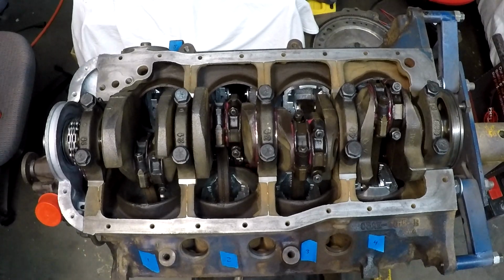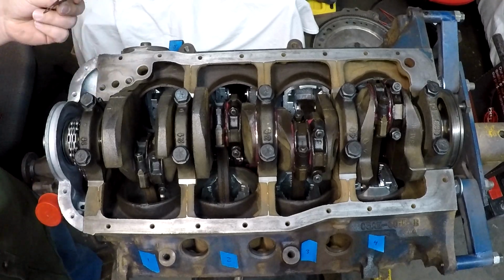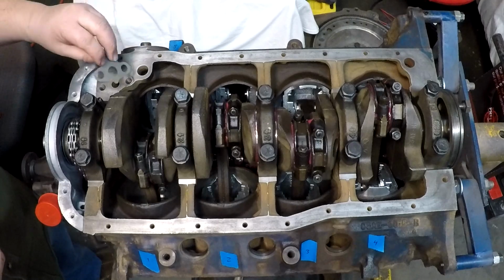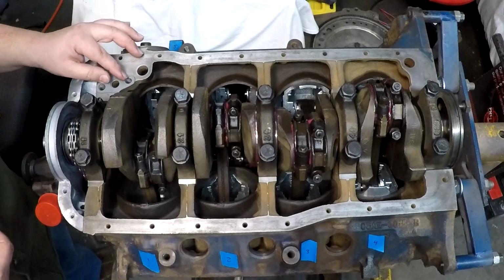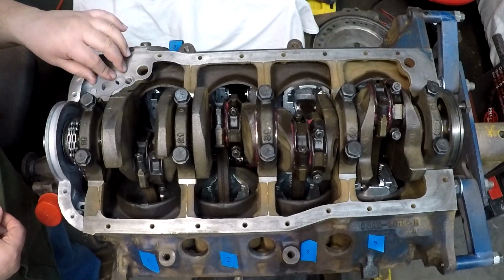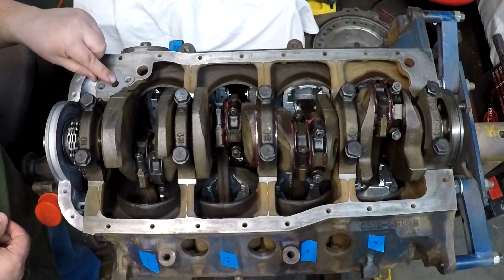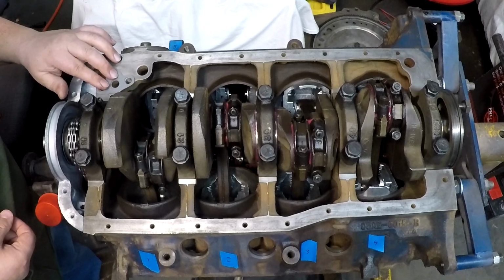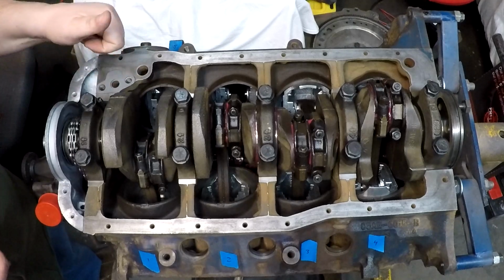We are going to put on our gasket, and because I have this nice little witness mark on which direction it was, and it really shouldn't matter, the thing will fit either way, but since I have a nice little witness mark, I'll just make it match the shadow. And it looks like, I believe that is it right there. Yeah. Pretty sure that's it right there. So, gasket is definitely larger than the hole in the block. That's good.